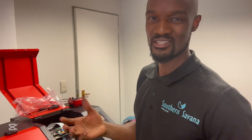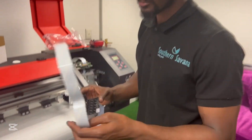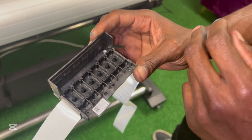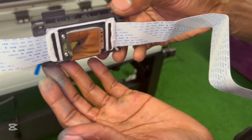Basically it's all the same — XP600, DX5, whatever it is — but the XP600 is called a budget head or a disposable print head. You have six slots here which take four colors: one yellow, one black, two cyans and two magentas, and this is what it looks like on the surface.